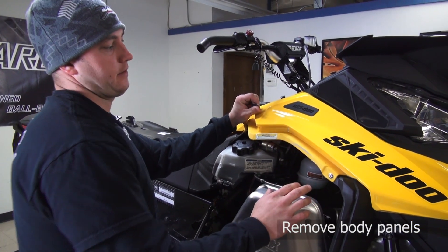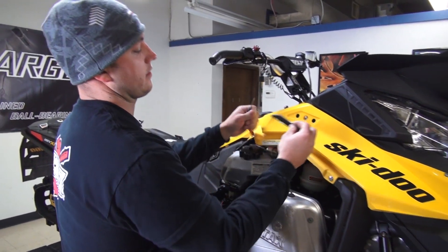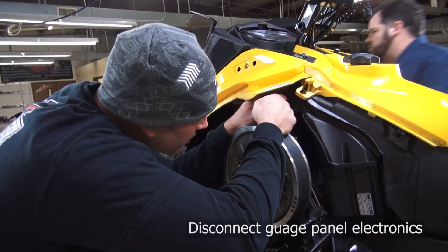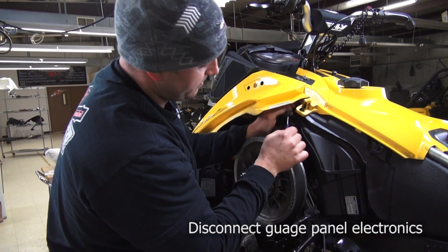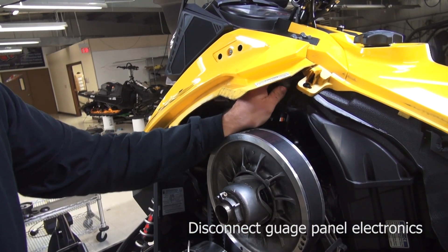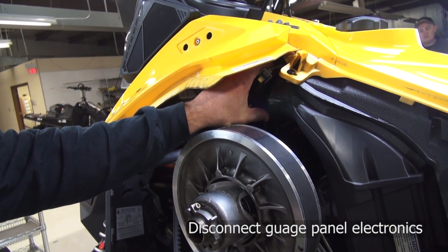You've got to take off six of these little Torx head bolts. You pop the little Ski-Doo plastic — it just pushes forward just like that. There's a sensor plug that you're going to have to be very careful with. There are two tabs. Tweak them out a little bit and push up, push out on this tab here which releases it — push out on both tabs, push up. There's also a little tab here that you'll have to push, rotate it clockwise, and then it should slide forward and disconnect.